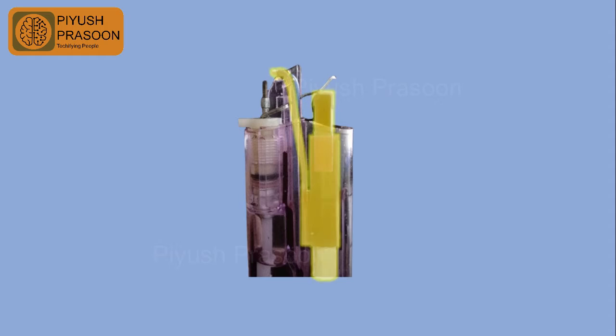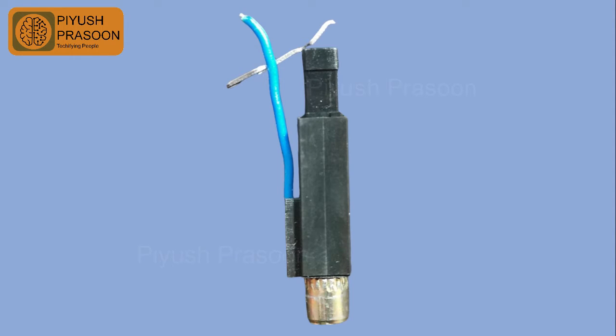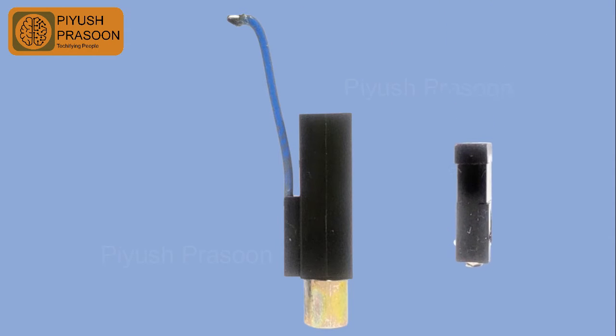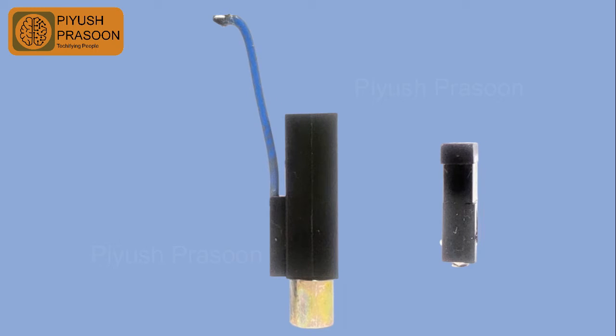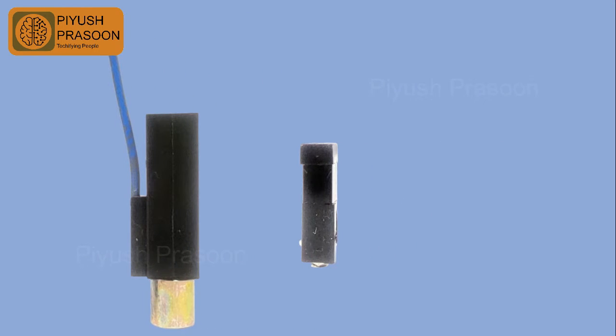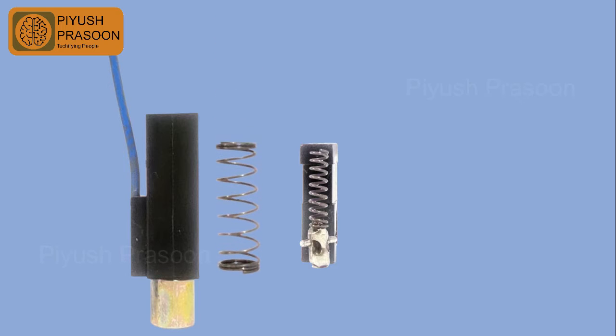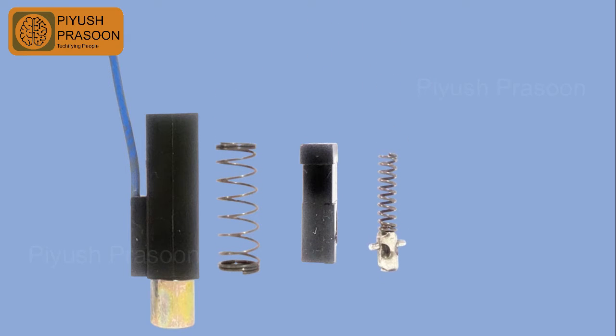I have taken out this part and it will look something like this. Now let's remove the metallic lever — and this is the push button. It came out of the main unit, and if you could see, both units are having a spring residing inside them. Let's take out the spring from the base unit and the push button. The push button spring is attached with a metal which is working as a hammer while hitting the piezo crystal.